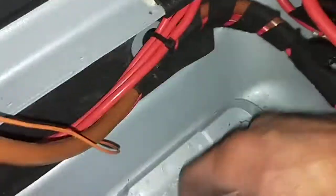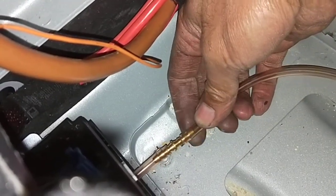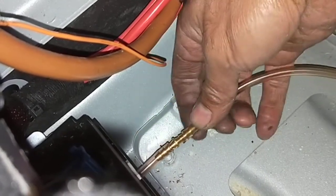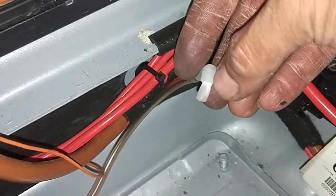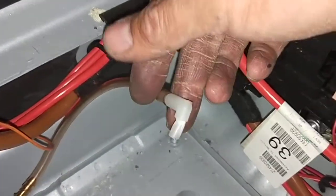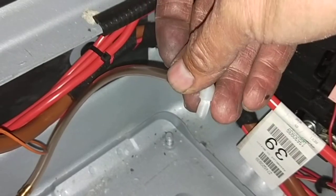When I took the old battery out, the hose was already broken, just sitting there. So what I've done is I got a brass T-piece and put it between the two broken hoses so I can fit the battery in and connect the vent line. The poisonous gas needs to be vented to the atmosphere — if you have a little baby or kids in the car and it's not connected properly, they'll be breathing those gases, which is very harmful.